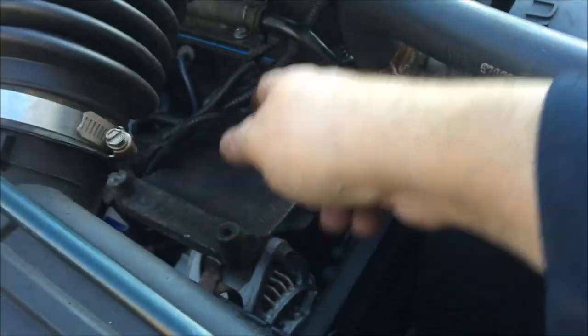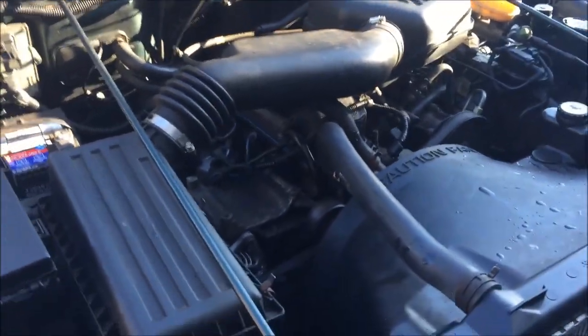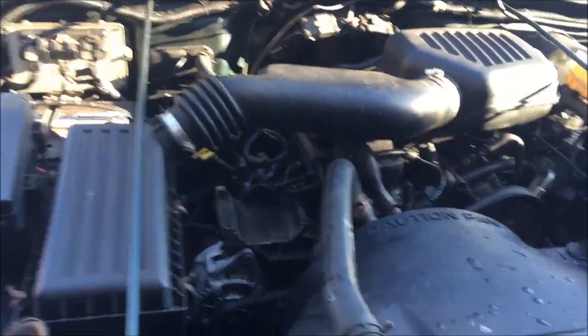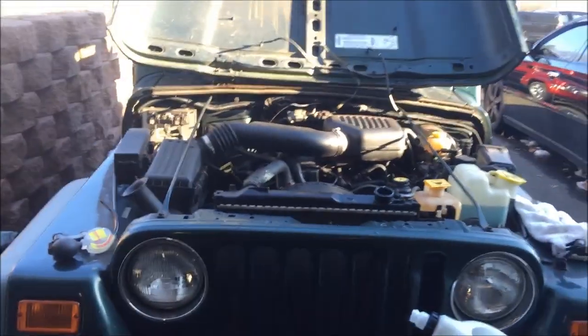One thing I want to point out, when you put this new tube on, this one, that goes into the top of the water pump, make sure you put that on while it's outside of the car, because it's so much easier. So that was just the only quick tip I got right here. Everything else was pretty easy. Yeah, so we're good now.